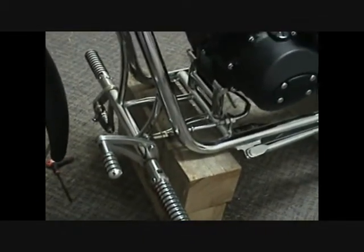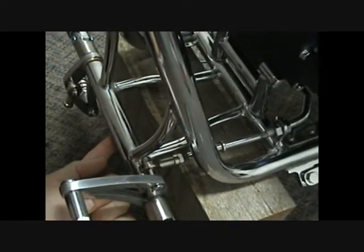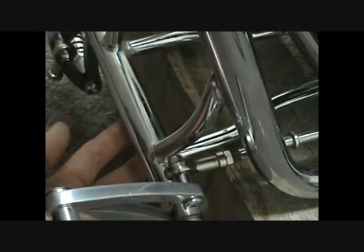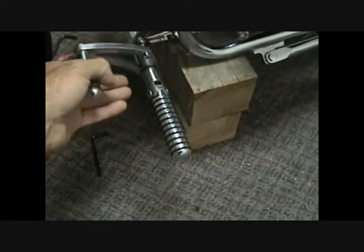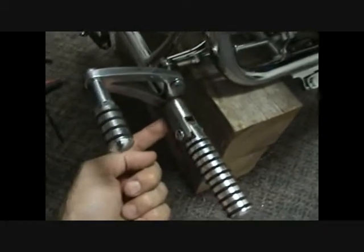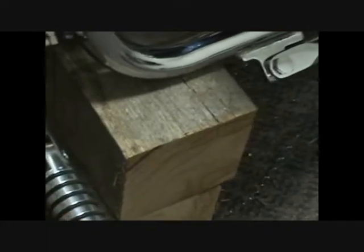Another thing to note is installing the foot pegs. There's a main rod that runs across the center, and underneath there is a set screw — I would definitely use red Loctite on that to keep it from falling out on bad roads. You twist on both foot pegs and they have a set screw on the bottom side. Make sure the foot pegs are lined up correctly and not too far forward so that they fold back up when you put your foot on them.